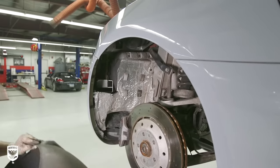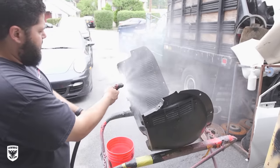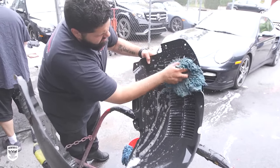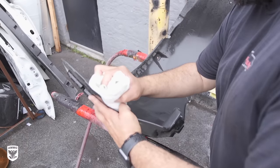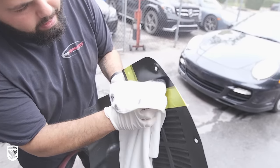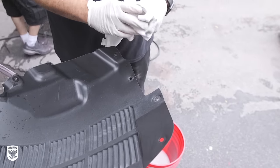While Hank was playing with the pistons, Mario cleaned the wheel well plastics to enhance the depth and contrast of the caliper against the background of the wheel itself — that's how crazy these guys are about doing a complete job. He pre-rinses and washes the plastic thoroughly with a heavy degreasing soap, rinses, then dries with compressed air and a towel. Once 100% dry, he added three coats of trim black to the faded plastic. We did a quick 50-50 shot to show the before and after — this is a way better contrast than the original whitish plastic, and will make the caliper pop out much more.